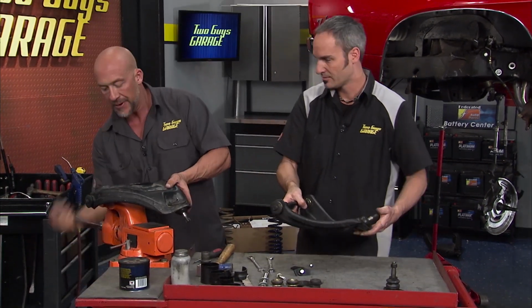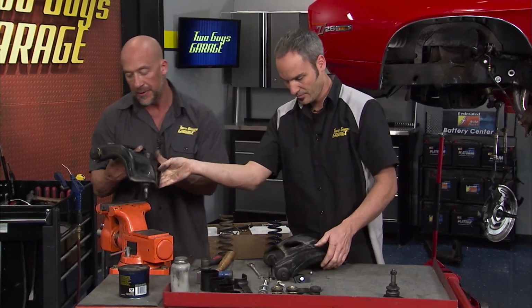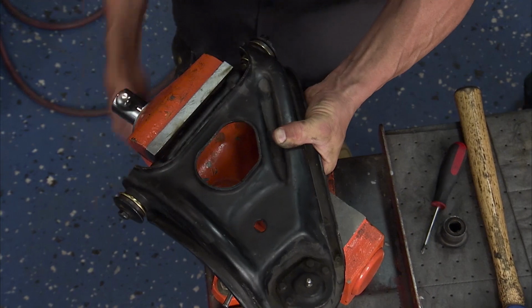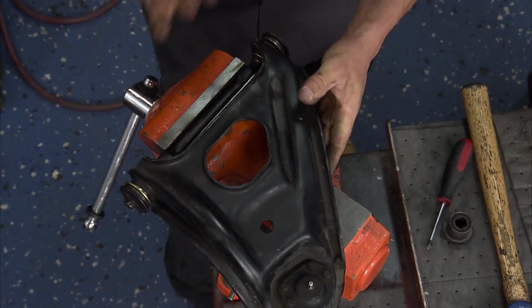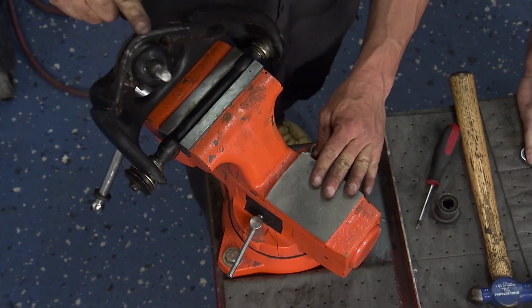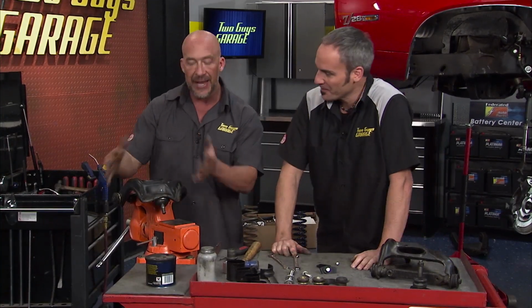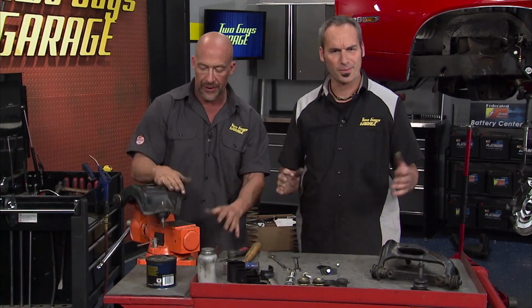Right, so that's not allowing your suspension to move the way it needs to move to do its job thoroughly. So the great thing, like we said earlier, about these, you put these Delrin bushings in there, and man, talk about movement, right? Look at the difference. That's some free motion right there. Yeah, man. That's gonna allow that suspension to do everything it's designed to do versus fighting that swelled up old rubber. No roadblocks. Exactly.